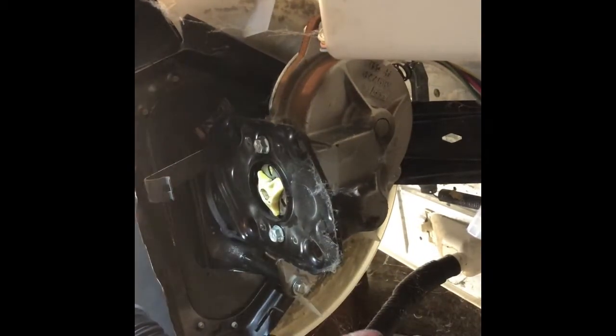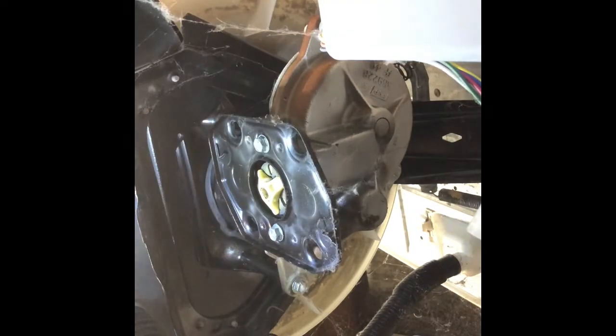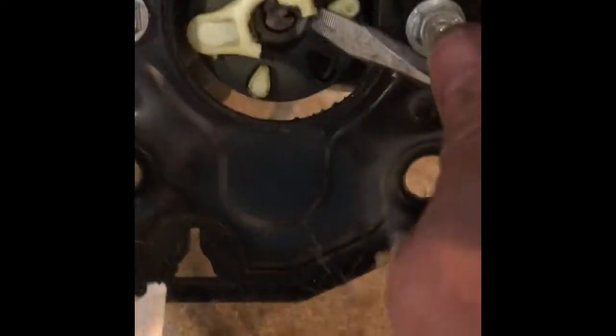And there is our motor coupler. This one appears to be cracked. It has 2 fork assemblies. The front one, closest to us, that one's snapped. Probably got overloaded with a big blanket or a bunch of bathroom mats, or too big of a load. So we have to be careful with this machine not to overload it.